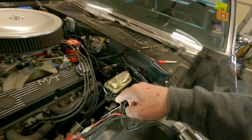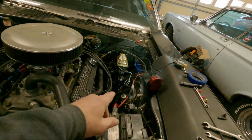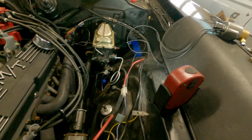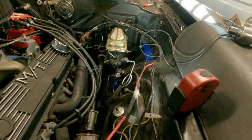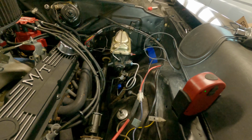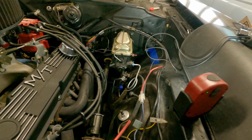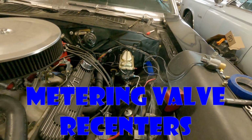The other thing that concerned me, I started thinking, will the prop valve, you see that little thing there? If you lose pressure, that pops out. And when you bleed the brakes, that pops out, hence that thing right there, right? Well, he said he's got them on his Dart, and sure enough, the brake light does come on, but it goes back. Now, the way the factory service manual says, and it works on my 2nd gen Dodge truck, when you bleed the brakes, you just stand on the brake pedal and it'll pop and it goes back. Hopefully, it'll just do it on its own.